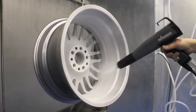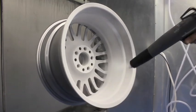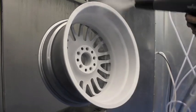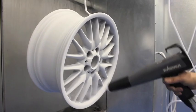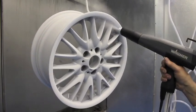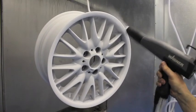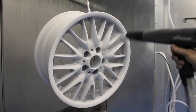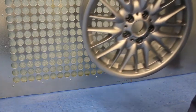These can be easily held up against your car and this gives you a really good idea of how it will look. The final process is the application of an acrylic lacquer, which can be seen here being applied as a white powder. This turns clear during the final curing process, which takes place in our oven at 180 degrees centigrade. This leaves an incredibly hard, robust and protective finish.